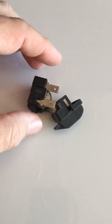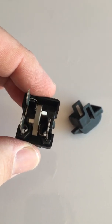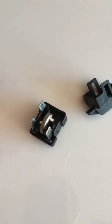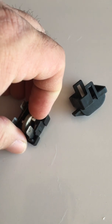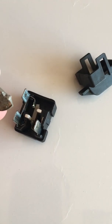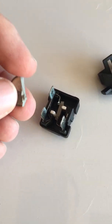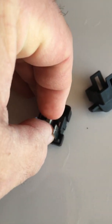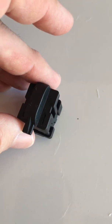This is referred to as a relay. Inside of this box is a ceramic disc, and whenever the thermostat calls for the freezer to cool, the power goes through this ceramic disc and then into your motor. Unfortunately, this particular ceramic disc ran into a problem — it broke in half. When it broke in half, there was no more current able to flow through it, and even though the thermostat was calling for cooling, the freezer would not turn on.